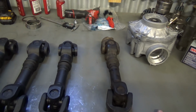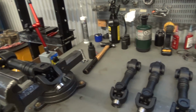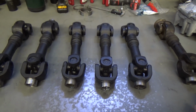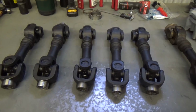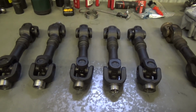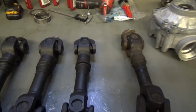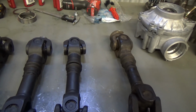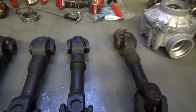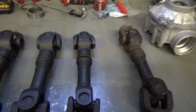So in my research, I ended up buying 6 Can-Am brand new prop shafts out of the box. I measured them all. Every single one of them was out of phase to 1 degree or another. I took them to a prop shaft or driveline shop, had that confirmed. I also had them cut and reclocked to get the phase to 0. I also had them straightened and balanced.